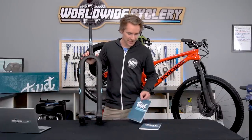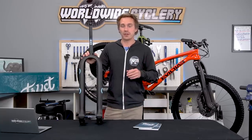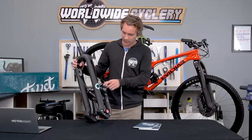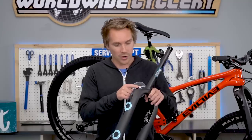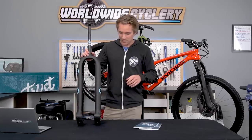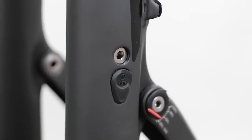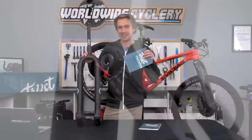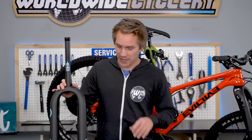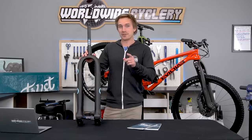These forks come out of the box with a setup guide and an owner's guide, which is very useful because you set them up a bit differently than a traditional fork. It's not all that hard though — it has two air valves that need matching PSI, a single rebound adjustment, two low-speed compression adjustments, and an open/medium/firm adjuster. Nothing too crazy, but you do need to set it up to Trust's specifications. They detail exactly how to set it up based on your body weight and riding style. We actually have one of these forks available for demo and purchase in our California and Pennsylvania locations — come in and try it out.